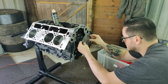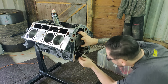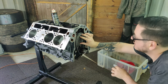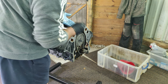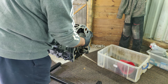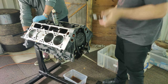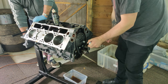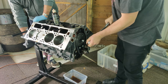The next step in the engine build — and arguably one of the most important ones — is the timing chain and cam timing gear itself. The cam gear is driven by a chain which in turn is driven by a sprocket on the end of the crank. It's a very simple setup with no tensioner and no other devices; it's literally just two gears with a chain connecting them. The cam gear has raised sections that allow the cam position sensors to know exactly where the cam is in relation to the crank. There's no adjustment and no longer any VVT in this engine as we've removed it, so the ECU won't be making any changes to timing based on RPM or load, but it does need to know exactly where the cam and crank are in relation to each other.